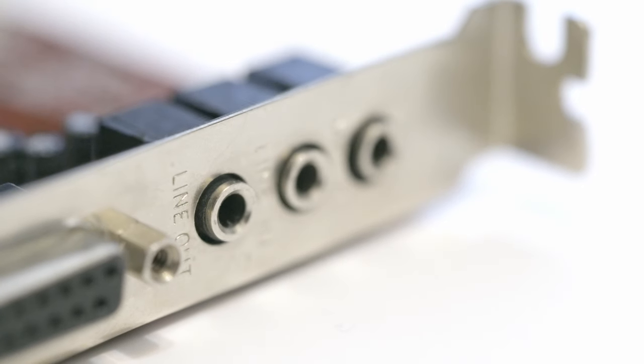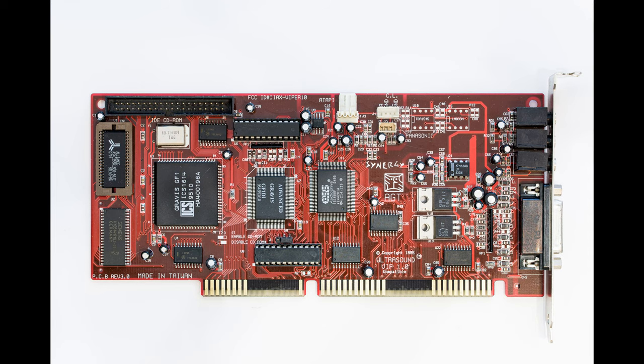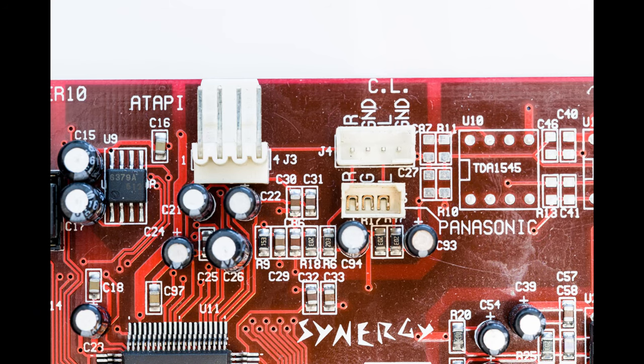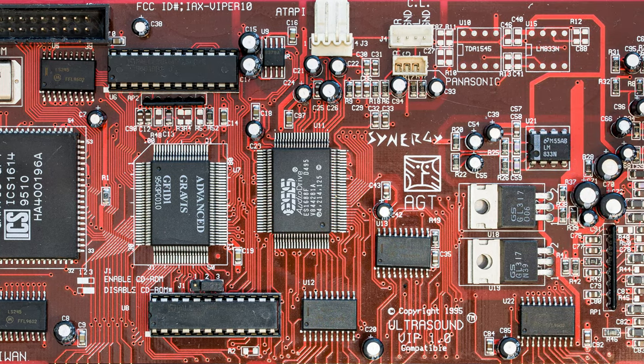Next to the line out are line in, mic in, and a game port for joystick or external MIDI module. Unfortunately, there's no Wave Blaster connector, so if you want to use a different wavetable, you either need an external MIDI module connected through the game port or a different sound card. As usual, there's an IDE connector for connecting CD-ROM drives. I wonder if anyone ever used this connector. Next to it are all types of audio CD connectors, which is a nice touch, but it's missing a PC speaker connector. There are no jumpers on the card, so the resources like IRQ or DMA have to be set up